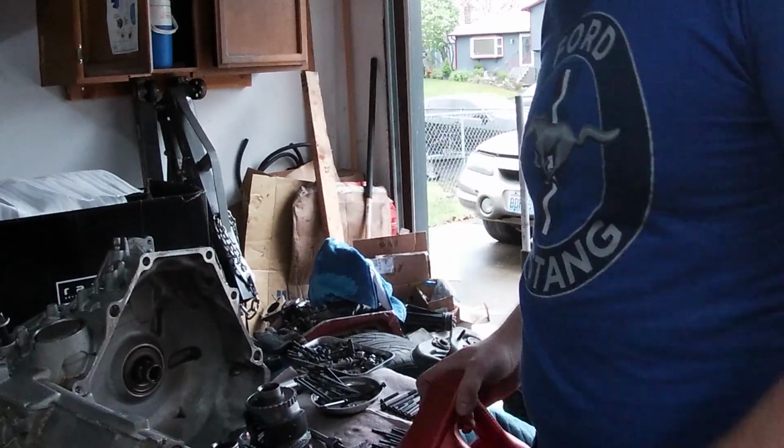Right. Anyhow, let me update you guys on the thing delaying this project the most. I bought a 4340 input shaft from ZZP, brand new. I bought that because it's a better alternative than stock, and they say the stock one breaks in a car making 300 wheel horsepower or more. That's one of the first things that goes in the trans. Triple Edge's one is like $400, and I wanted a better alternative than stock, but not one that was $400. So I bought it from ZZP.